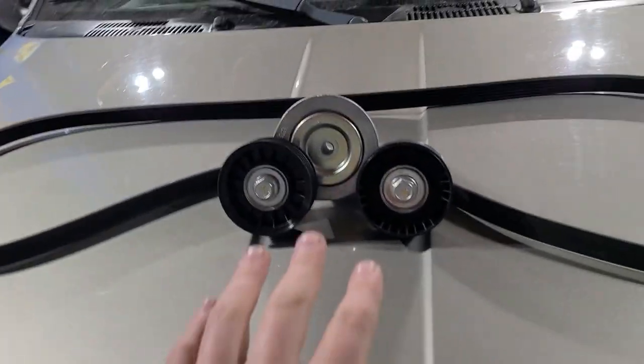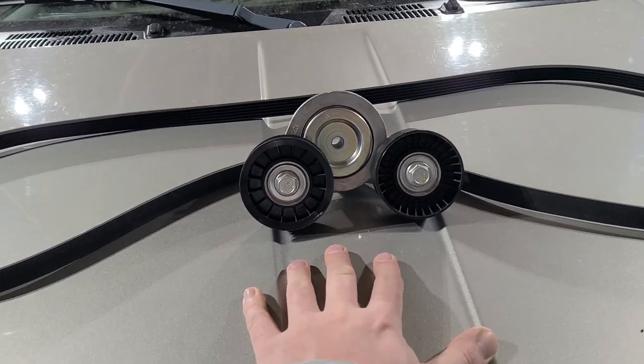So I bought a new serpentine belt last night and threw it on, and that eliminated about 80% of the squeal. There's still a little bit. While the belt was off I spun a couple of pulleys — everything's good except the tensioner, which is making some squawky noises. So I bought a new tensioner. This is a Gates brand — I'll link it in the description below. For those of you that want to help me out, click on the Amazon links below; I get a kickback anytime you order something. I also have a Zelle and a PayPal link. Those help keep these projects going.